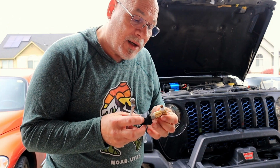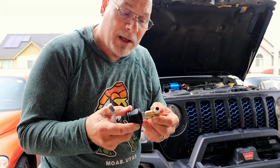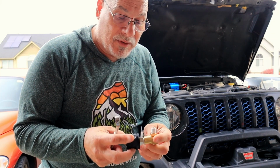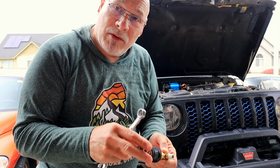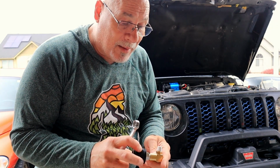Okay, while I was in there wrapping the Teflon tape around my fitting here, I went ahead and mounted my chuck. It's got a good generous amount of Teflon tape. Make sure before you screw it on here that the tape isn't laying over the hole. Sometimes it'll stretch over the hole. Do your best to keep that from happening.